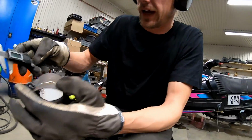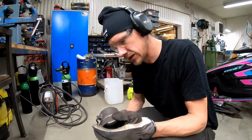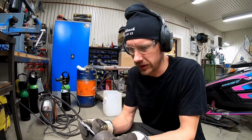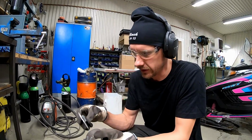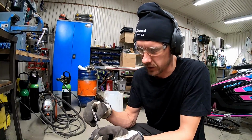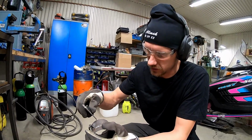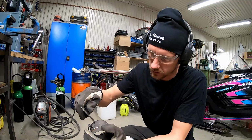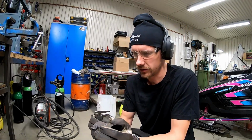Now I'm making this 8 millimeters because of the thickness of the disc. So I'm losing 1 millimeter per cut. So that's why I'm using 8 millimeters and cutting away 8 millimeters. And I will try to have the disc on the inner side of this line. I should get around 1 centimeter.